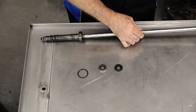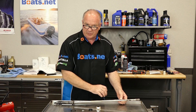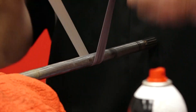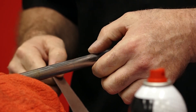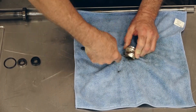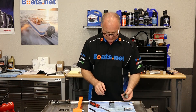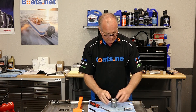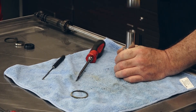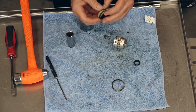Let's get the carrier out of the way. I'm actually gonna take this over to a vise, get it held in place, and straighten up where I've scarred the shaft itself. At that point, we'll come back, get these old seals out, and get the new ones pressed in. Much better — now that we've got the driveshaft straightened out, let's go ahead and start working on the seal carrier. We're gonna use a couple of different sockets — one as a cup to drive into, and a 19 millimeter up top to push them out. Now we got them. I'm gonna carry this over to the parts washer, get all this corrosion scrubbed off, then we can start putting it back together.